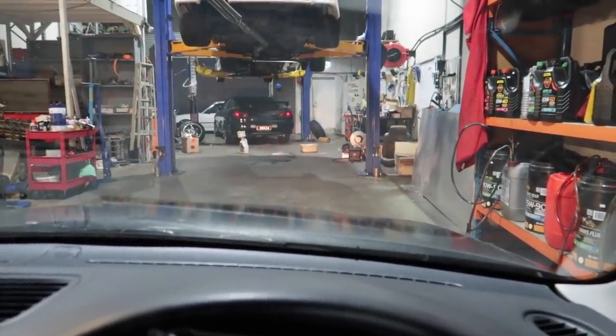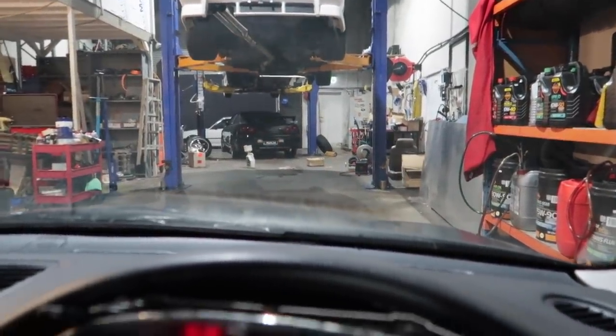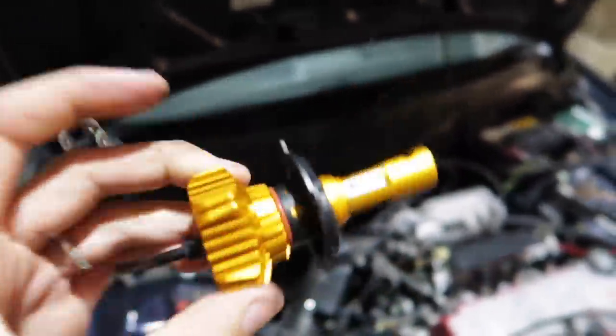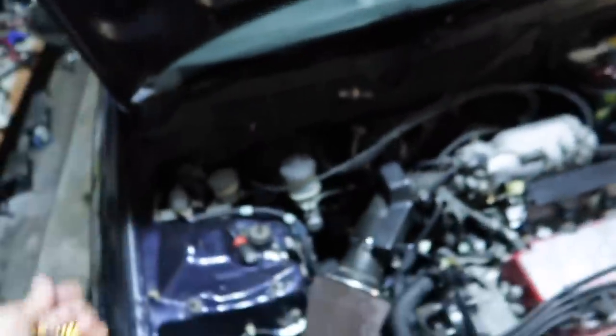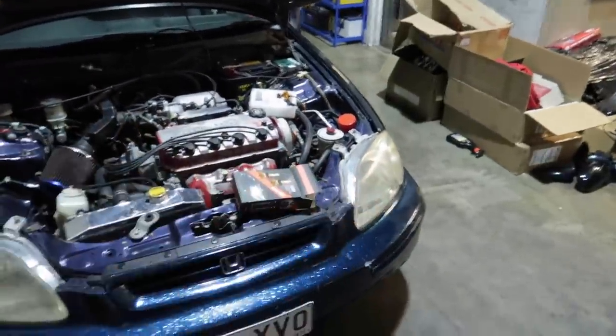I'm really curious if these headlights are actually decent. Look at my headlights right now — they're pretty pitiful. So it'd be interesting to see how much of a change they are. Let's pull the key out and put this thing back together. So I just removed the old H4 bulb and I'm looking at these new ones and they look so good. The LED H4 has got the heat sink and everything on there to keep it cool. I love the fact that the plug itself is like a little extension bit that comes off it, so you've got a lot more room and it's easier to pull the bulb off the actual facing. So I'm going to install this. I've also put the LED little tail light in there as well. And then we're going to have a comparison — the LED on this side and the normal one on that side — to show you guys the difference.